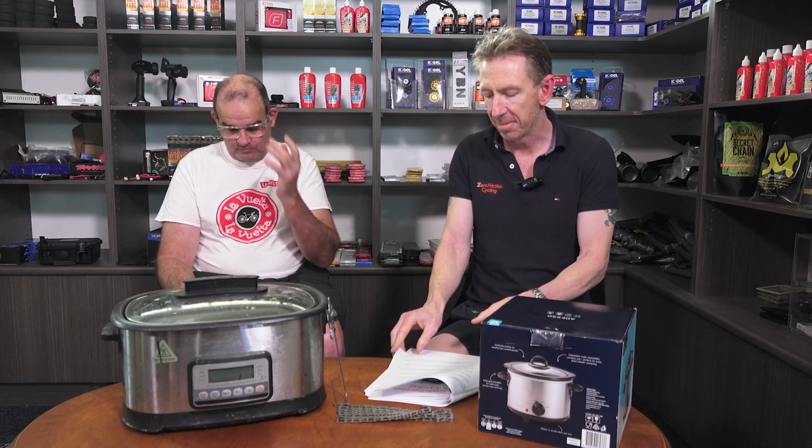If DIY waxing is your thing, go for it. Just take the advice on the base. Take note of the total cost if you're getting stuff from everywhere, and my advice would be that unless you're using a really super refined paraffin base, whatever you make is not going to be great. It's likely to be really gunky and dirty. It's a lot of the DIY waxing that leads a lot of the bike store mechanics to think that waxing is pretty crap, because they see these bikes come in so gunked up that they can't even shift into the smallest cogs.